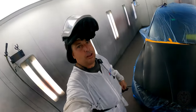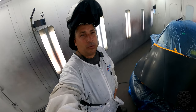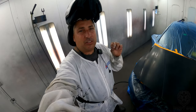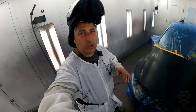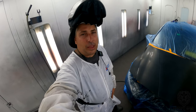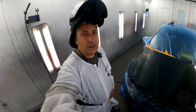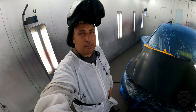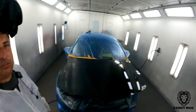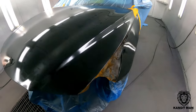I used to use that LPH mini gun for ghost chrome — it was a ground aluminum paint in alcohol from the corporation that makes a lot of custom paint. You had to have a very small tip to get that mirror-like finish; it was called ghost chrome. I'll be doing a video on that and on what I do for hyper wheels. Even with factory paint, I've got a concoction I make that can duplicate the hyper wheel look. One of you guys asked me to do that, and I'm just waiting to get the right wheel. Let's finish up shooting this one — it's just a black metallic.